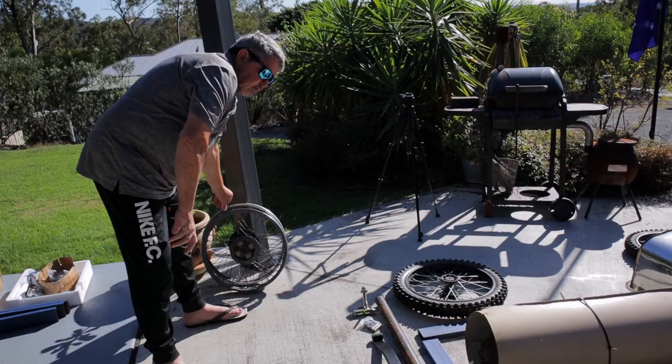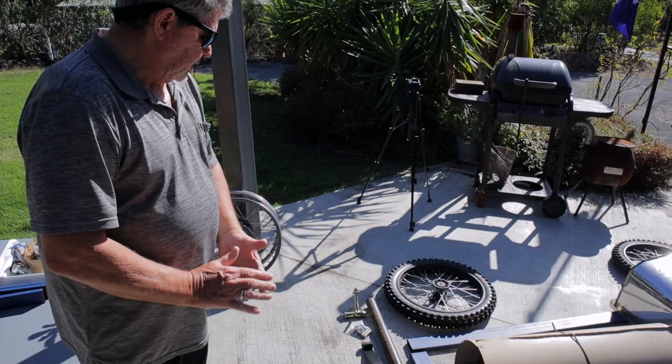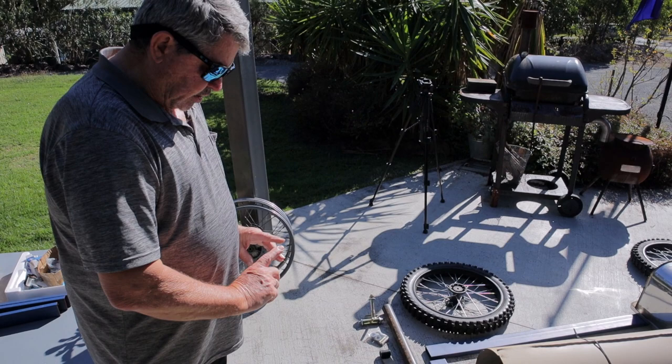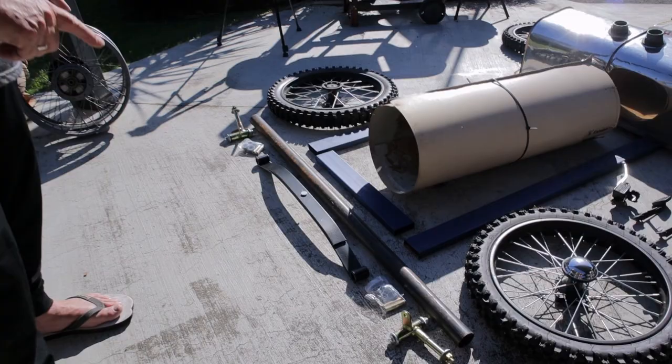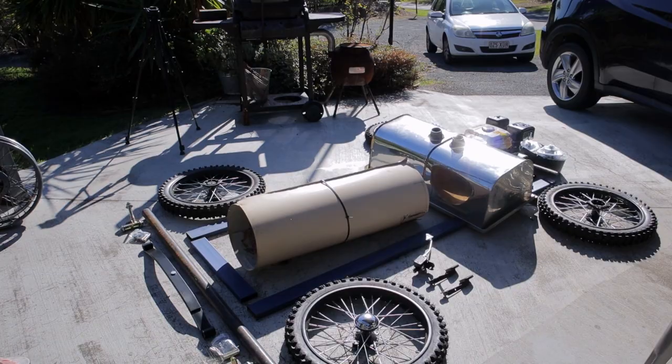I'm going with aftermarket wheels I found online — we'll just see how it goes. The front suspension is usually two leaf springs, but I'm doing a transverse front spring to sit into the original format of the A-Model Ford, so that's a single front spring with a front axle and wheels attached.